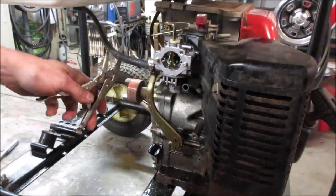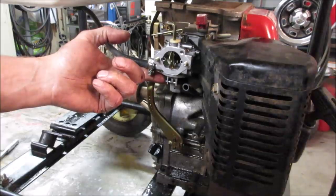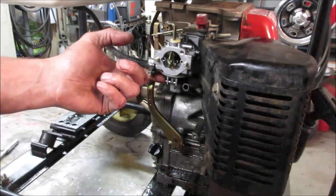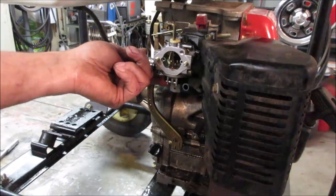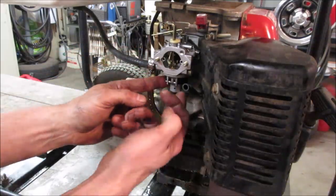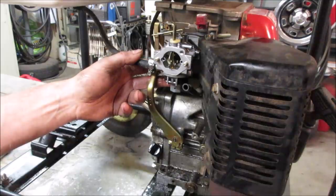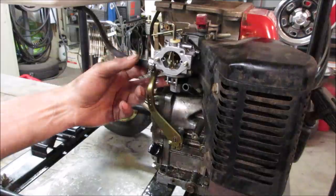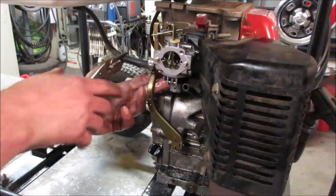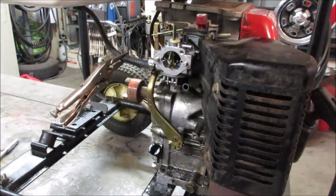Just quickly turn that gas on. Sometimes you get to give her a couple of shots and just hold that up and see if it shuts off. It's taking some decent pressure for it to shut off. Nothing saying that the nipple on the needle isn't bad neither. I looked at it, I didn't see anything. Clean itself out a little. All right, I'm gonna throw the bowl on it real quick and I'll release it and see if it overflows again. If it went away, I'm just gonna leave it. If not, we have to take that apart and take a look at the seat of that needle.